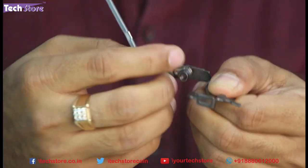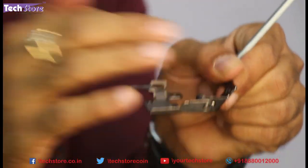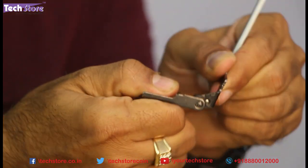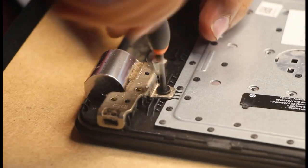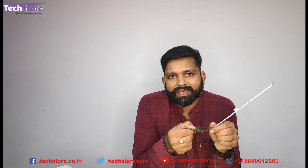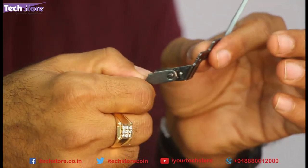When you are opening and closing, the problem is when the nut holding the two parts is very tight. It becomes very tight to open and close, and the screws held by a female screw inside rip off because they are held onto a plastic fiber body. Most laptops that come in with this problem have either the lower part — where your keyboard and touchpad are — or the upper display frame ripped off.